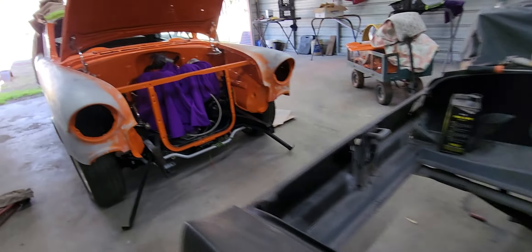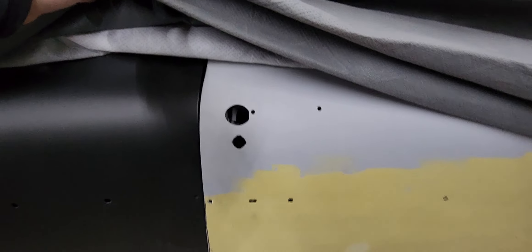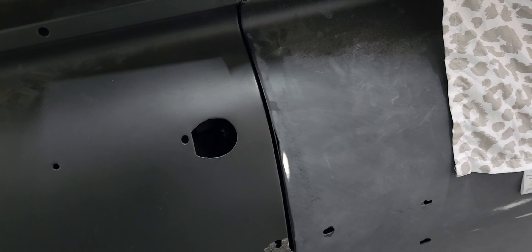Of which most people are never going to notice anyway. I've actually started to spend more time on gaps as time went along. Doing that right now on my car here — these doors had to be replaced from here down, so I had to do some grinding here to get that gap opened up. But up at the top here this is strictly adjustment, and I'm real happy with how that turned out. I thought I was going to have to add some metal to that and ended up I'm not. Still got to get the hinge in the door. You can see where I need to still do a little work here on the edge — got a good gap coming down here and then it gets wide right here, so I'm going to add a little filler right there on that edge to tighten that gap up.